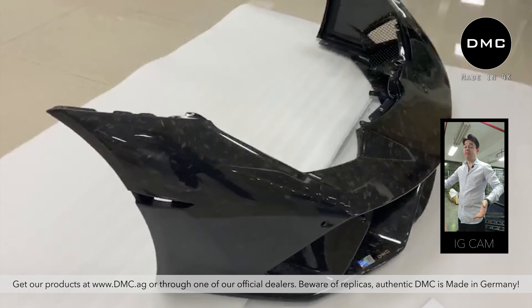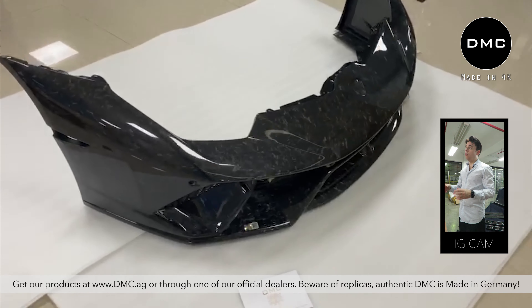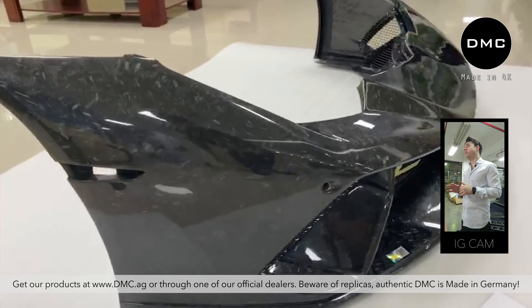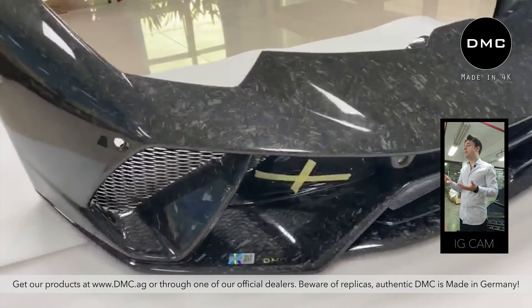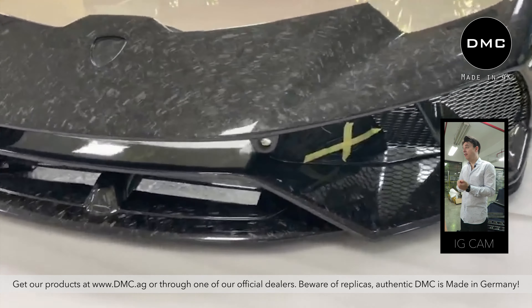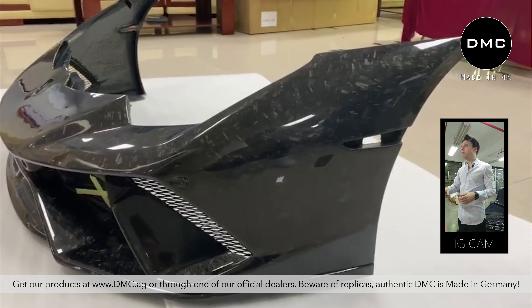Mixing is the right step because your car is probably not brand new. Even if you got it brand new, it may have already stood outside the dealer for one or more weeks. When the car stands outside it gets affected by UV light — some more, some less. Sometimes it affects the clear coat, sometimes even the color. There are certain weather conditions to consider. So even if you have a specific color, say Lamborghini Huracan blue X1, after a few weeks that blue is not going to look the same as the original anymore. You want to make sure your paint shop mixes the color so that it matches the UV-affected conditions.